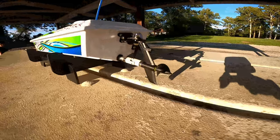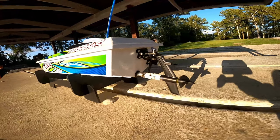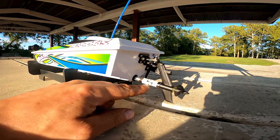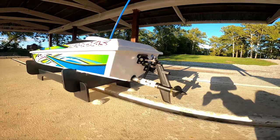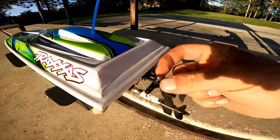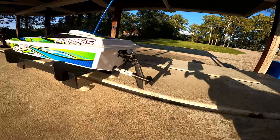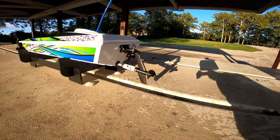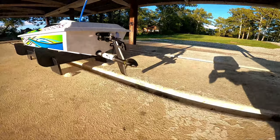First thing about this: it has a pretty unique style thrust system. It uses the prop actually attached to the rudder with a U-joint to drive it and turn at the same time. You can actually adjust the prop angle up at the top with this bolt and nut here — loosen it up and slide it back to give the prop more angle up. We have not messed with that at all yet, just left it be. It's running perfectly fine as-is and we have taken it out one time. It does move pretty well. As you guys can see, this is a plastic prop — it's a twist-on style prop.